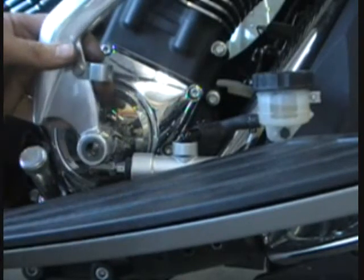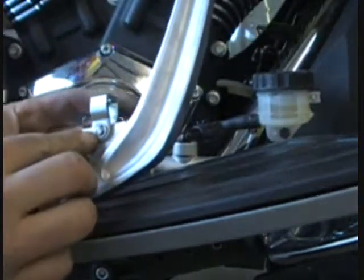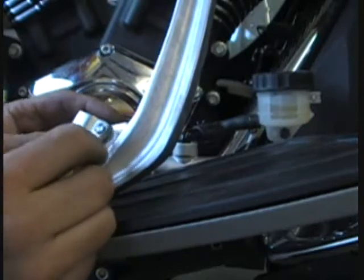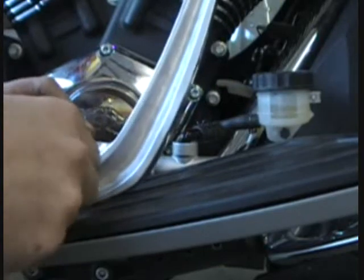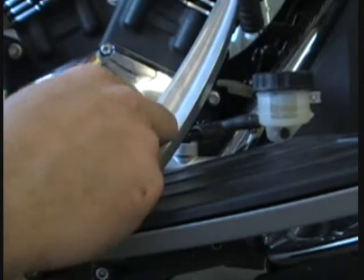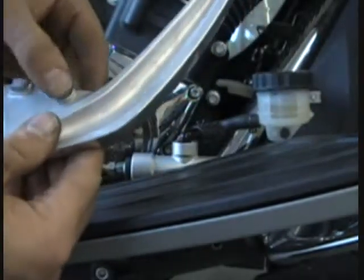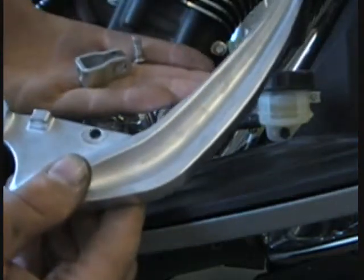So you get a much more solid feel when you're doing it. On the back of this, if you flip it over, there's something called an e-clip right here — it's just a little clip. Take a regular cheap screwdriver, just a little tiny baby screwdriver, and you'll see little notches in there. If you just put it in there and kind of twist it, just be careful because sometimes those things can shoot across the garage and you don't want to lose it. Just take that little clip off. Now there's a pin in there — just push the pin out and it falls right out. Very easy.